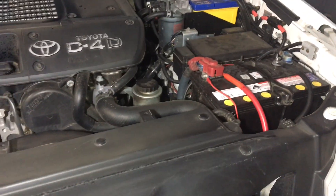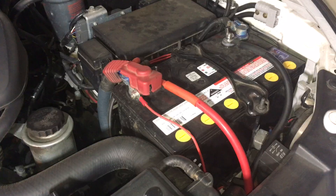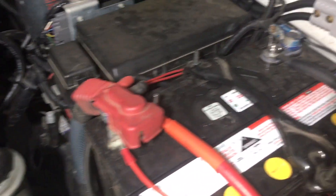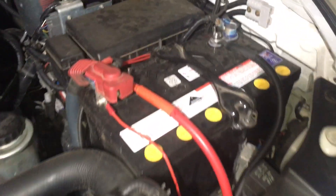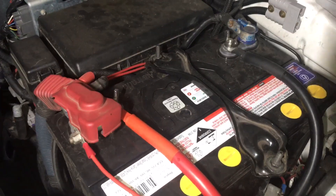Have you seen the problem? Anything red - positive - from the battery. Let's quickly recap for people that don't know: in an automotive battery system, generally almost all vehicles are negative earth. That means you've got a positive and a negative. The positive is red, the negative is black. The black is the earth - it's connected to the car body. The whole vehicle is ground.